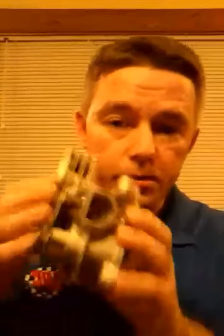You want to, it's got to breathe. I mean, that's the initial breath. That's the first place the air comes through. So that's got to be one of the truest parts as far as the way it's worked and the way the fuel signal all is in the carburetor. And head work and valve size and all play a big part in that. It goes through the carburetor first, then it comes through the head. We went over porting, AKRA porting a few weeks ago, and I showed you places in there to port. That was for basically stock engine.